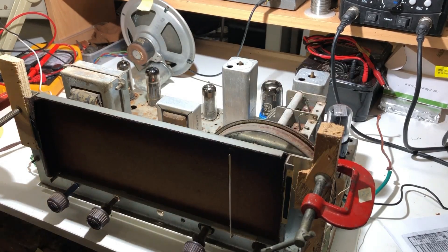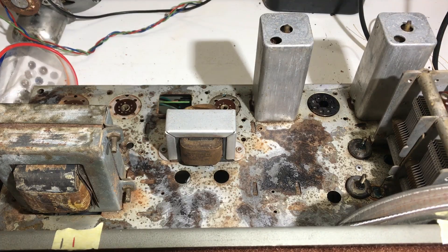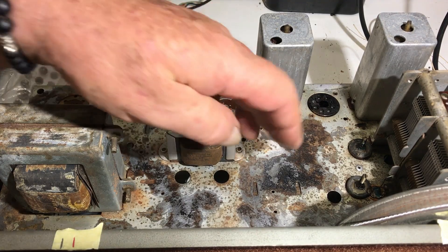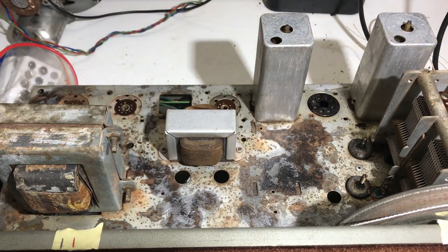The only problem is I suspect the fault will reappear when I least expect it. I've been a bit busy but didn't video all of it - I've basically just rubbed back the worst parts of the rust with sandpaper and given it a coat of rust converter. I'm waiting for that to do its magic; it's slowly starting to turn black. I'll give it a coat of something protective like zinc coating over that. I'm not going to try and make it pretty because this chassis isn't seen.